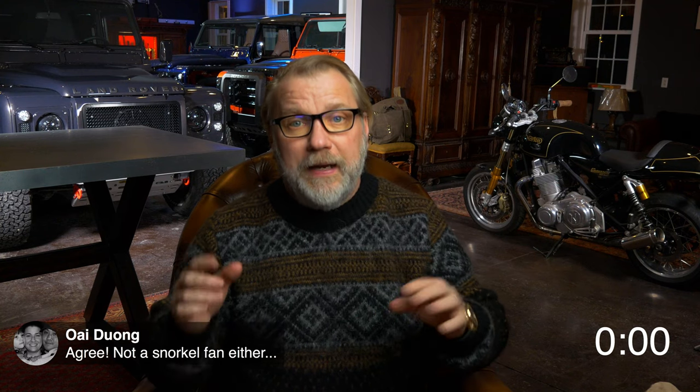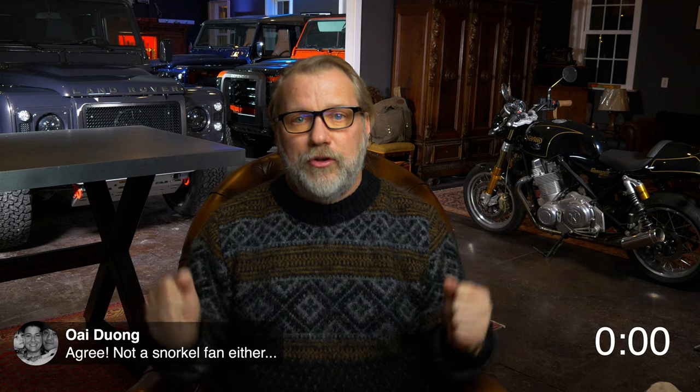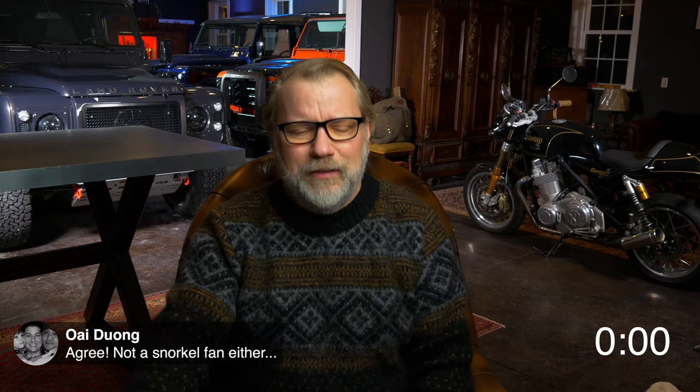I am building two trucks right now and we are putting snorkels on them, but they will be fully functional. One truck has a TD5 and is basically a Spectre build almost to the T, minus the rear hydraulic brake. It will have 37-inch Maxxis Trepidor tires, bead lockers, the Helderberg performance package bumping horsepower to about 190, the right differentials, the right transmission, rose-connected shocks, and canvas straps attached to the A-arm and frame so the coil springs don't pop up during serious articulation.